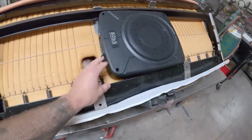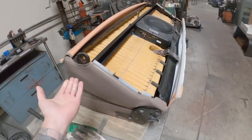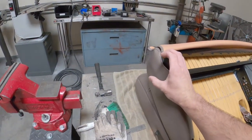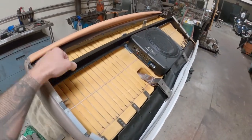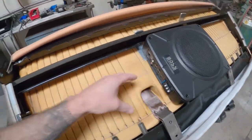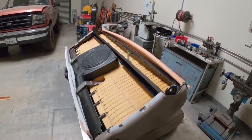If you own a Ford Bronco, you know this bench is obviously removable relatively easily — there are just some pins and the thing folds up and down inside the truck. My idea is to run all my wiring right to the pivot point and leave some slack so I can still move the seat. I may also do a quick-release harness right inside here so that if I want to pull the bench out, I don't have to come to the amp and disconnect all the wires — a quick disconnect plug is just cleaner.